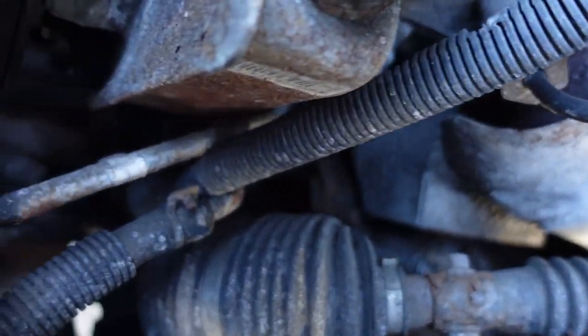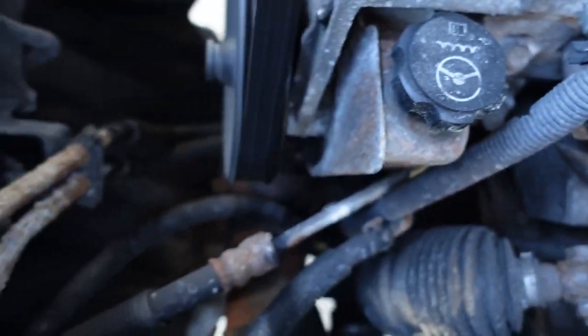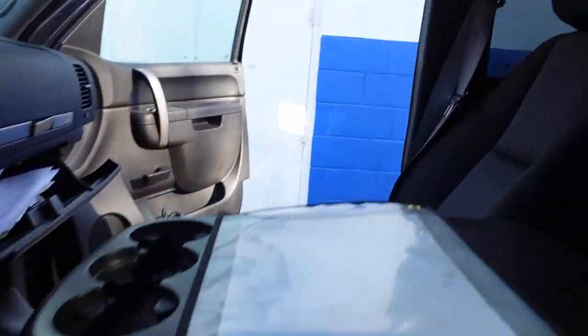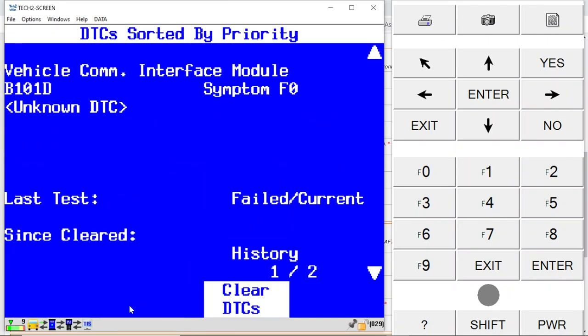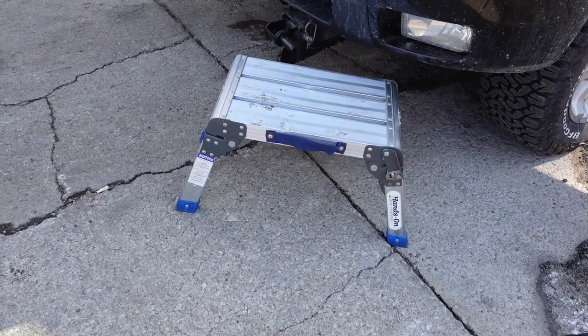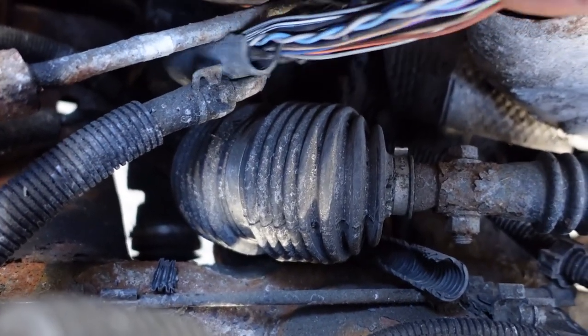There is a wire harness that is on the power steering line right now — it could be pinched. I'm going to turn this off so I don't chop off my fingers. Before I get my stool, let's view all DTCs. Vehicle communication interface module problem — not so worried about that — and a P0340. The whole vehicle only has two codes. Being this is a plow truck, I'd really expect to have the problem down here near the power steering lines.